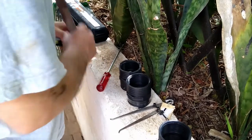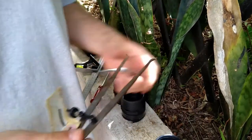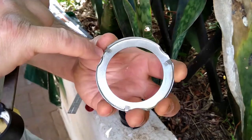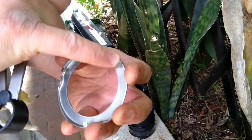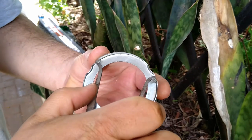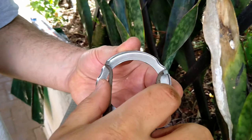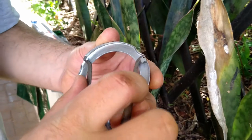How to do this is, first of all, I take a caliper, right, an inside caliper. Okay, and I first of all get the caliper adjusted to go from the clip where you're going to be applying pressure to the next clip, at the exact spot that you'll be applying pressure again as well. So I adjusted the caliper so that it fits that distance exactly. And I've checked to make sure that this ring, which is probably made in China, is in fact accurate all the way around.